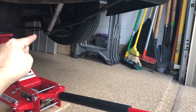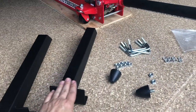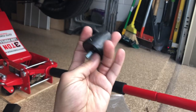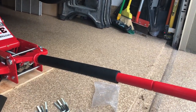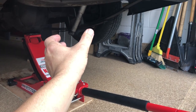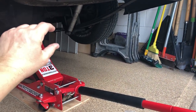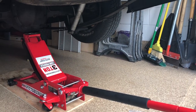When the vehicle is sitting level on the ground, you want this bar to be parallel with the frame, and the very tip of this to be about a half an inch away from the spring. So what I'm going to do is go ahead and put these in place and just not tighten the bolts, just put them enough where it kind of holds everything in position. Put it back on the ground, make sure everything's level, and then go ahead and make sure my rubber end is a half an inch away from my spring.